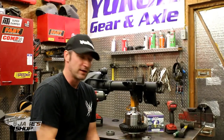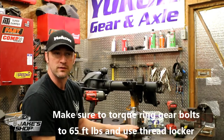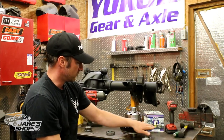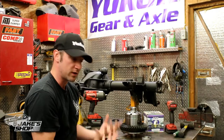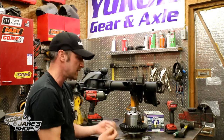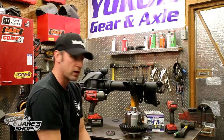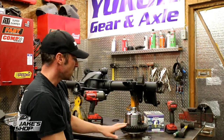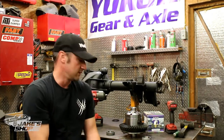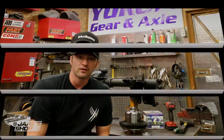Next step in the process — we'll go over the press and I'll show you what's next. What we've got here is the carrier. I went ahead and pressed one of the bearings on — there's a bearing on each side. The real tricks are getting a socket or pipe cap that'll clear the hub on the differential as the bearing is getting pressed down. When you look at these bearings, you want to make sure you're putting most of the pressure on the inside of the bearing — you don't want pressure on the outside. I can get most of the pressure on that inside lip while the outside of the bearing clears. Your carrier is basically now ready to go ahead and go into the housing.